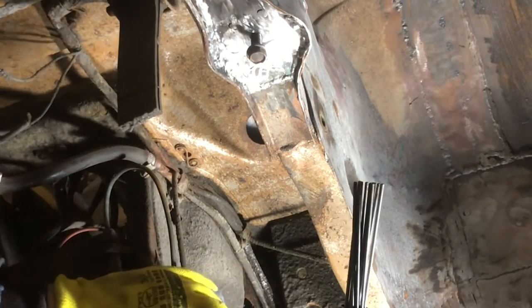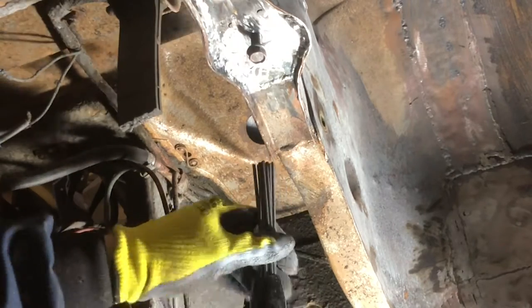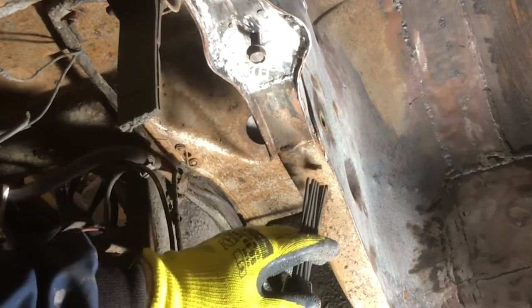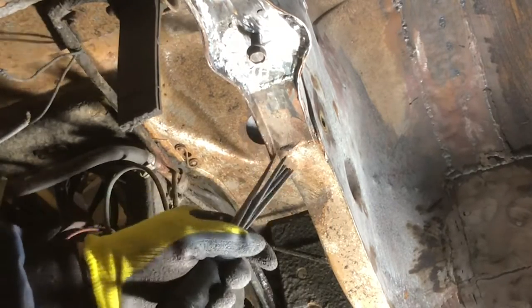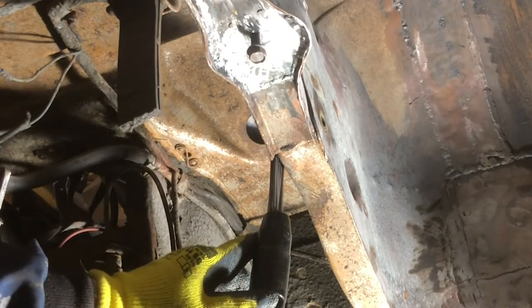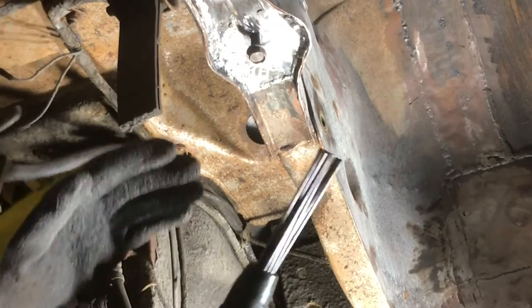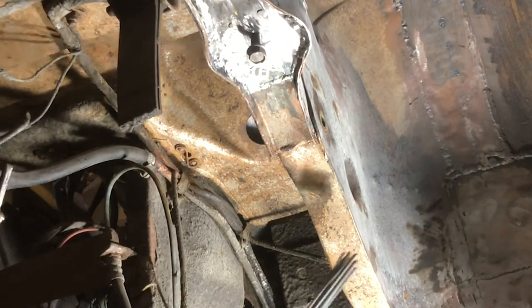So there's loads of different techniques to this, and they're not all, you know, as hard as you can, because quite often, remember, these needle scalers are going in and out. You can actually push the sealer into the corners, which is what you don't want. You want to take it off. So yeah, you're going to see me pushing it that way, using it like a scraper, using it side on, pressing it hard, not pressing it hard. There's all sorts, so there isn't just one way of doing this, and it's like any tool, the more you use it, the more you become adept with it, hopefully, and more effective it can be. Right, let's keep going.